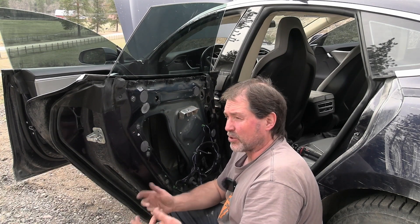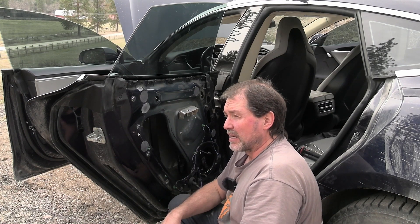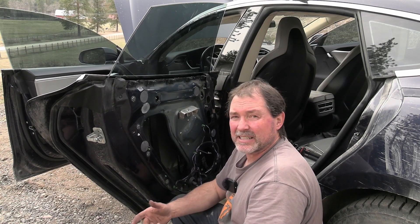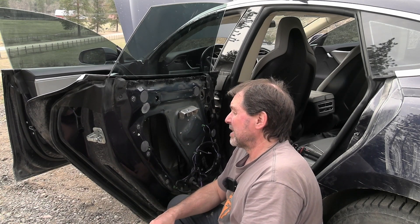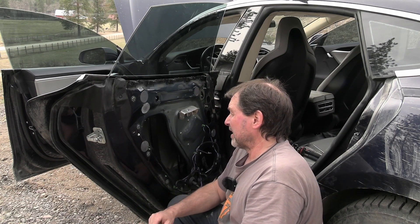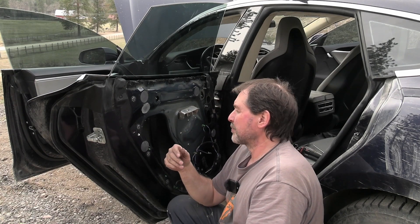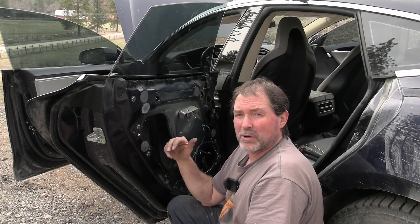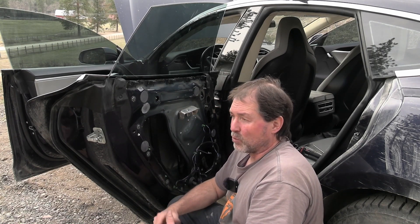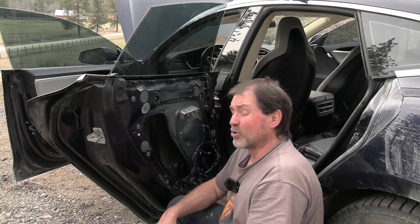So I got the bad feeling here that it is this little control board on the door handle that is causing the issue. Assuming that the plugs I unplugged are going to the motor and the light — they both would be activated by this control board. If one of the two would have a short and been activated the whole time due to a faulty switch or something, it still should have taken away the short because I unplugged them. And even if the switch still would send a signal to the control board saying 'move the door handle,' and the control board would put power to the door handle motor — either one of those two that I unplugged would have been that, and the short would go away. But it's not. So I think we need a new control board on there.